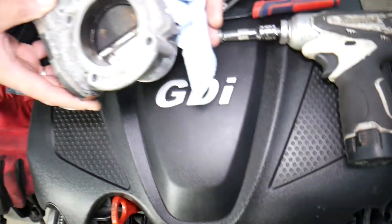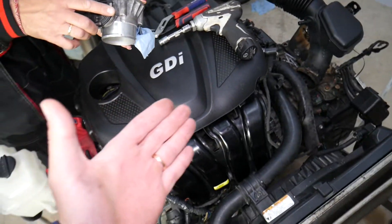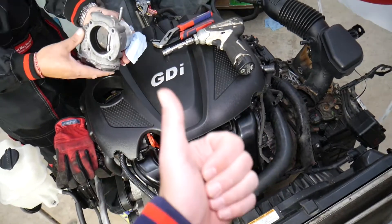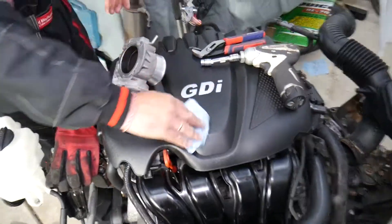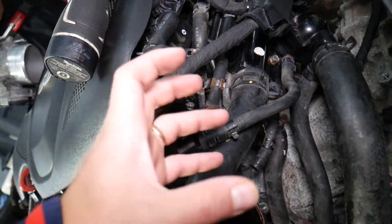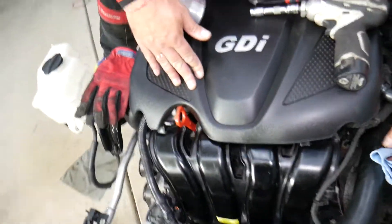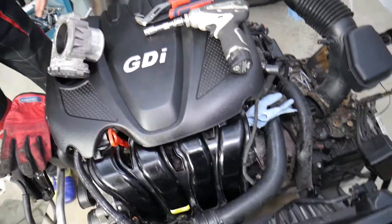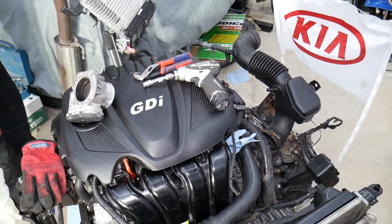After replacement, you need to add coolant — but most people stop there, and that's a big mistake. You need to bleed the cooling system. On Kia Sportage and Kia Sorento, the modern cooling system is complicated and can hold air bubbles, developing an air pocket that prevents coolant from flowing freely. As a result, you can severely overheat the engine to the point where you may need a new engine. Always bleed the cooling system — a complete video will be coming to our channel very soon.